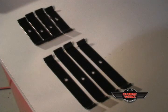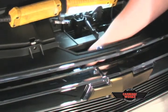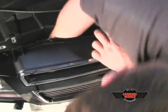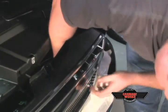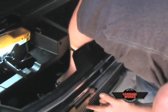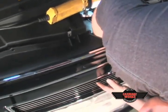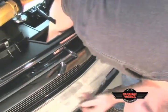These are the brackets included in your hardware. Notice that they are different sizes — the shorter bracket goes to the outside on both top and bottom. Now, simply place the bracket onto the bolt that is already through the billet grill, then place the nut on after that. Here is an example of how the nut will be placed onto the bolt. Now, simply tighten the bracket so that it is snug against the grill shell.